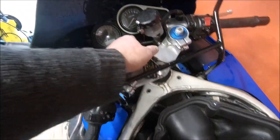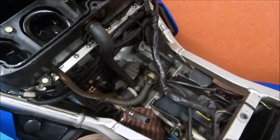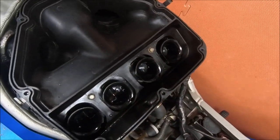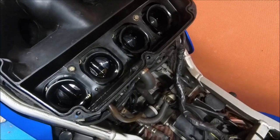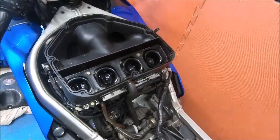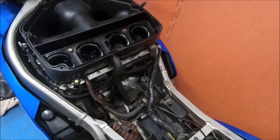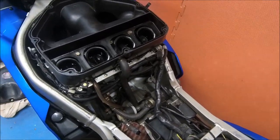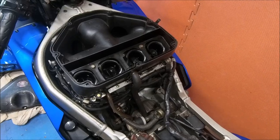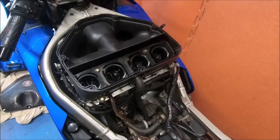Ignition on — pumpy pumpy pumpy pumpy — and give it a little bit of a turnover just to get that into the system. It might try to start but I've not got any choke on so hopefully it shouldn't. Well it did! Good stuff. Right, going to do that a couple more times just to get everything lubricated and any crud in the fuel system hopefully purged out. I don't really want to be taking all the carbs off — there's no real need, it was running fine before I parked it up. I'm under no illusion the carbs might need stripping down and cleaning but if they do, hey — it's another video.